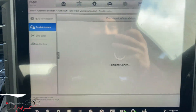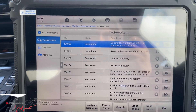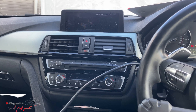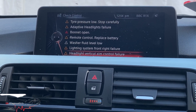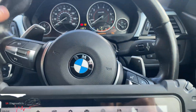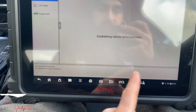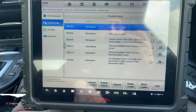You've got these two options — just click into that and then on here it gives you options. We'll go into trouble codes. As you can see, these are the faults with the headlight. If I go on to vehicle information, vehicle status — sorry, it's not service, check control — as you can see you've got quite a few problems. Another problem would be the parking sensor; I'll look into that later on as well. But for now we just have these faults. We'll code it in and hopefully it should eliminate all the faults, obviously except the parking sensor. You can try and erase it — this is the way you would do it. So you're now left with these — these are the ones that are faulty.